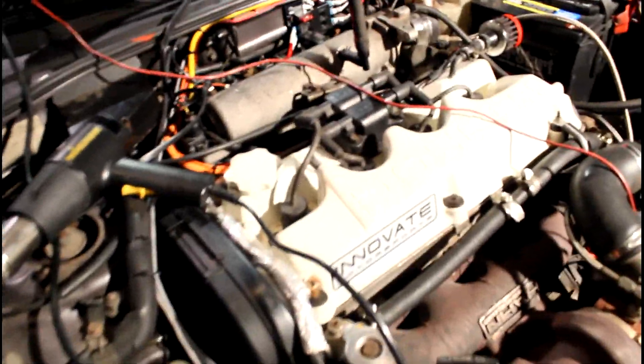I'm getting ready to crank the engine over for the first time without fuel or spark, so I'm not intending it to start right now. Got to get it cleaned off, still got some little tidbits to tie up — hoses, vacuum leaks and stuff like that — but it's mostly together. The fuel line is hooked back up but it's not really tight so it'll leak, and the fuses are all disconnected.